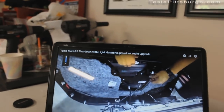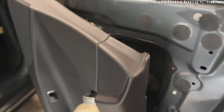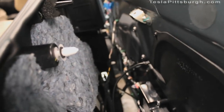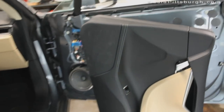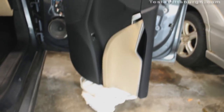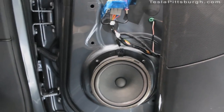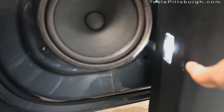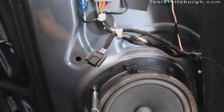They're going to go ahead and disconnect a whole bunch of wires in here. I'm not really sure how some of these connectors work, so I've decided not to do that fully, but I will show you what I did. These connectors are very tiny and very fussy. But I found that at least for the front door, if I pivot it and rest it on a big wad of fabric, I can get full access to the speaker and its connectors without taking any of the other wires off. Tesla even gave me a little work light on the bottom of the door. Once you've undone the clip, out they come.